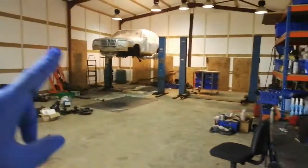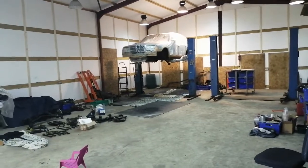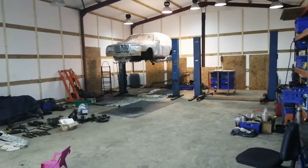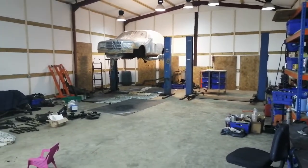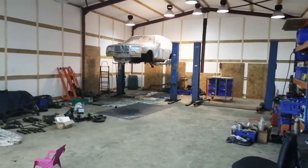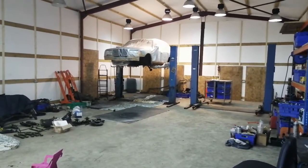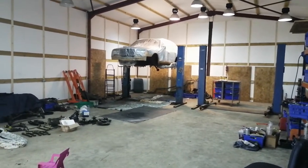So far it seems pretty good as a product, aside from a few little naggly bits. I'm going to leave that set now overnight, and then tomorrow I will start the actual spray coat across the whole underbody of the car, and I'm just going to see how many coats it takes. Obviously, you do always have to do at least 2 coats, because 2 coats is your best chance of getting coverage. With 3 coats, you shouldn't miss anything. But anyway, that's today, Tuesday, knocked off, and then I'll give you another update tomorrow.